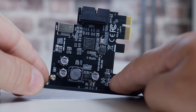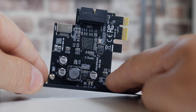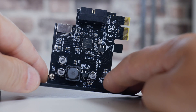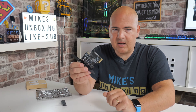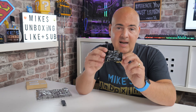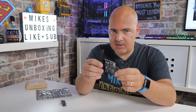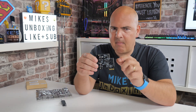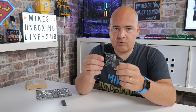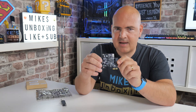You will need a PCI Express slot of at least Gen 2 x1. You can use PCI Express Gen 3 or 4, and obviously the better the generation, the better your transfer rates are going to be. Realistically you want to be looking at PCI Express Gen 3 or above to get the best out of it. This can potentially transfer anywhere up to around 600 megabytes per second, although with USB overheads that may not come into real-life situations. But generally for transferring from certain USB drives, you should be able to see in excess of 400 megabytes per second.